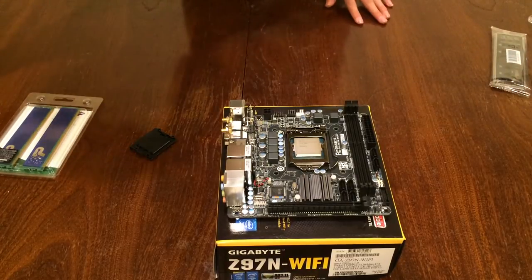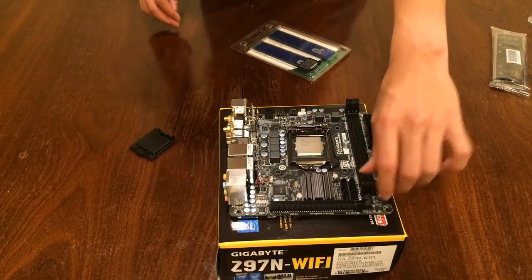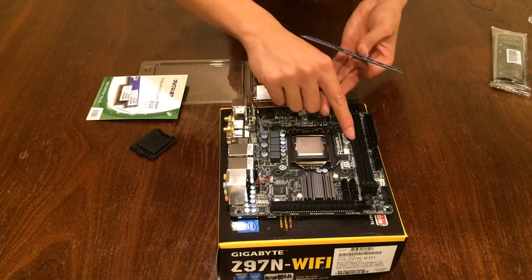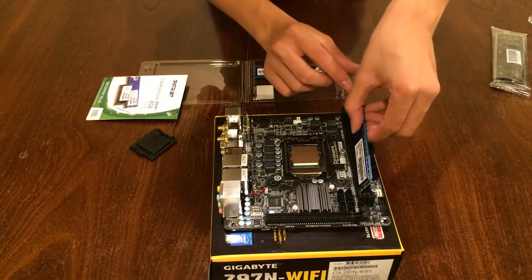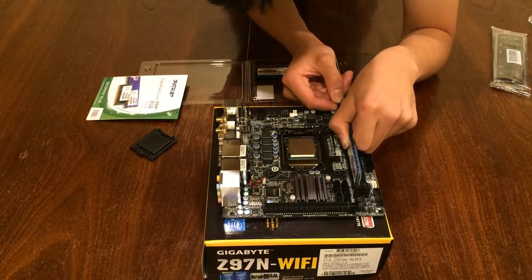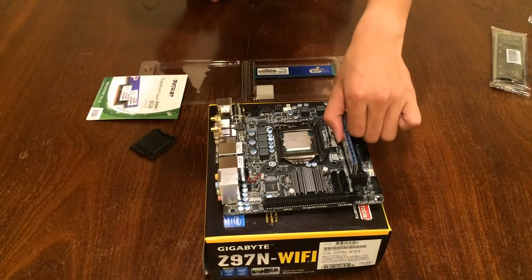This is even simpler. Well, yeah, I'd say so. Pull back the two straps, like so. Oh, these are mounted like that. So, okay, so you open your RAM package. Remove the RAM, and notice these notches on the actual RAM slot. Line those up with the RAM. Stick the fixed end in that end first. And just push down the RAM stick. Yeah, I was scared of breaking that first, but okay, make sure that it clicks on both sides, and you are golden. And that's your RAM stick installed.